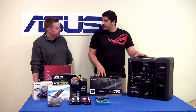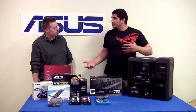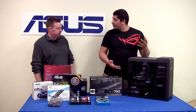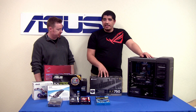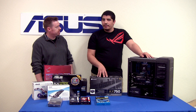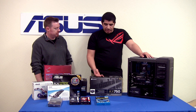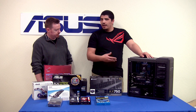The great thing about that is we get high-performance power delivery while maintaining the theme of being quiet - whether at idle, gaming, or fully rendering something. We get the nice bonus of 90% power efficiency. That also gives us upgrade support - maybe we want to go to two-way or three-way SLI down the road. Even though this is 750W, it's going to handle SLI no problem. It's really about the quality of the power supply you're utilizing - people tend to overshoot to 850W when they think about two cards, but that's overkill when you're using such a high-efficiency unit.